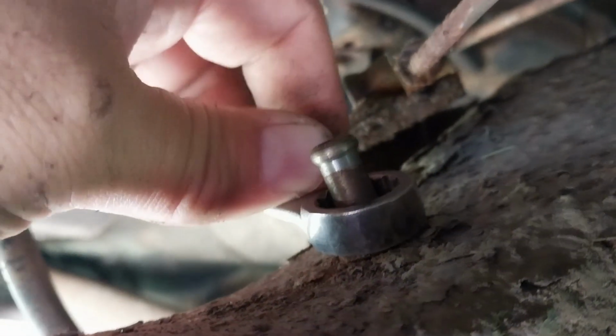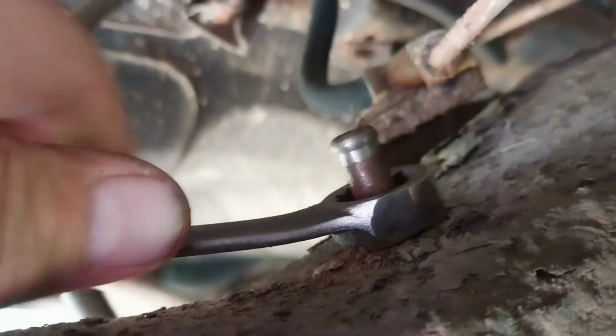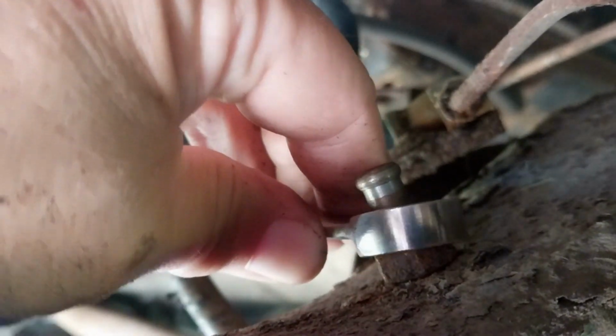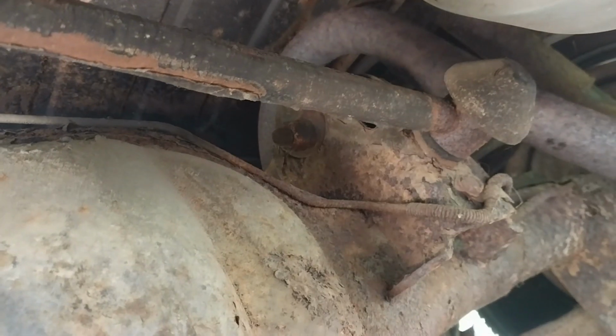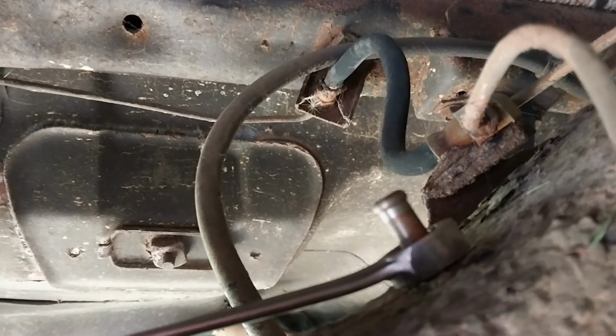You gotta be careful when doing this too, because when you open this, it's a 1/2-inch hole straight into the rear end. And a lot of these are actually mounted on the axle tubes. So this is a '73 LTD. And this is the kind that has what we call a Panhard bar in it. That right there attaches to that side, passenger side of the housing, goes over to the mount in the frame. I want to cut away and get this off and show you the rest.